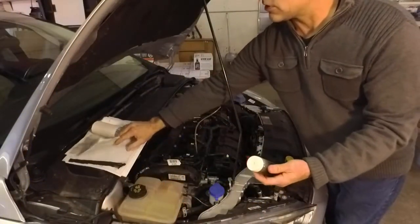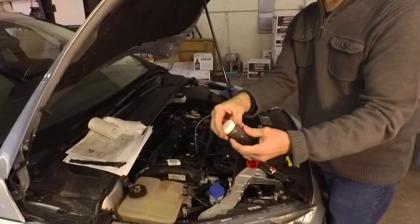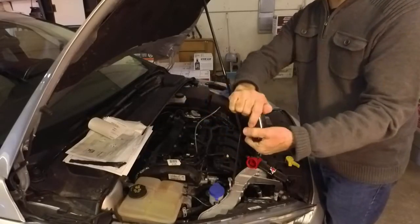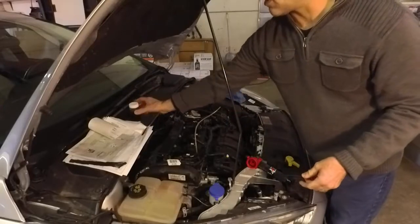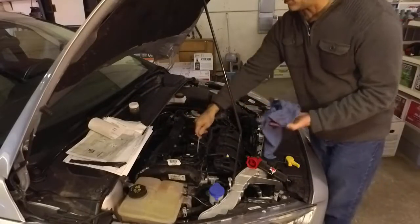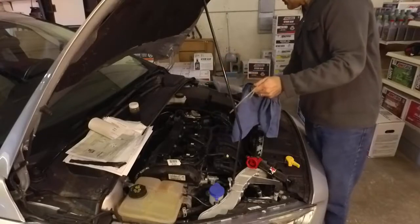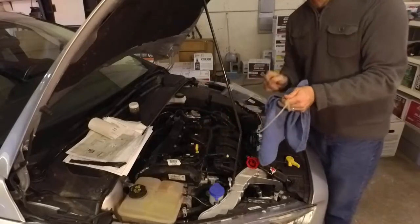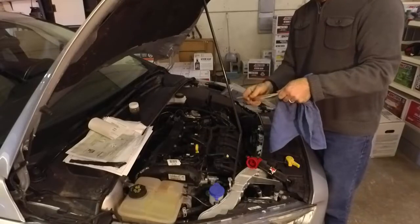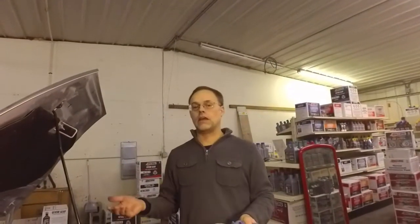There's the sample. On the instructions there's a barcode that you attach to the bottle. I wrap the bottle in paper towels before putting it in the bag, because if there's ever a slight leak you want it to reach the lab before UPS throws it away. Don't forget to put the dipstick back in and throw away the hose — it can't be reused. Lastly, check your oil level because you pulled eight ounces, and on a car that holds four quarts that's significant. When you pull that sample and replace it with fresh oil, that oil is enough to replenish some of the detergents you want in there.